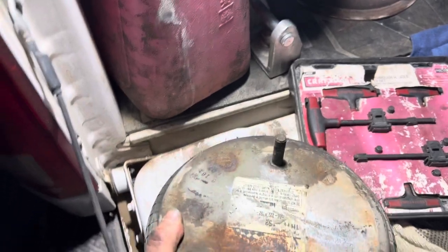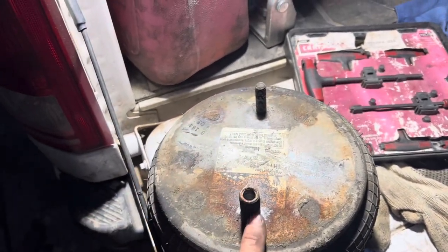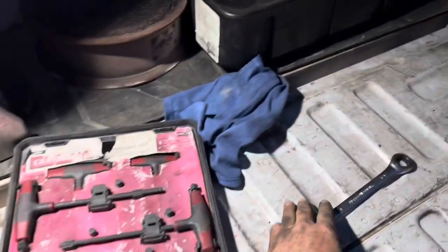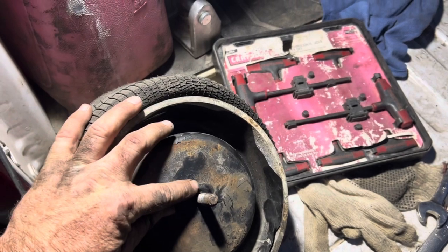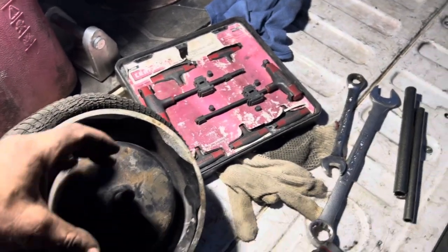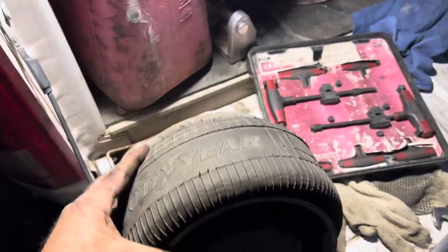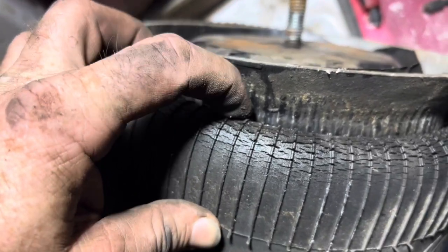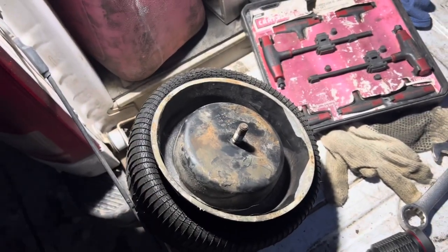This is the top of the bag that sits up towards the top of the coach. This fitting right here is where our airline fitting goes in, and our plate simply sits down over both of these studs. There's an inch-and-a-sixteenth nut mounting one side down, and a three-quarter inch nut mounting the other side. Then on the bottom, there's just a single stud that goes through with a three-quarter inch nut. The hard part about the bottom nut is there's a plate that sits over the top, so you can only get into it from the side — that's where the ratchet wrench comes in handy. This bag is our culprit. It is actually leaking between where the rubber is bonded to the metal plating, and it was leaking kind of internally above the plate, which is why even spraying soapy water on it I really couldn't find the leak.